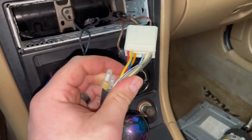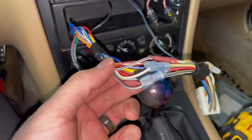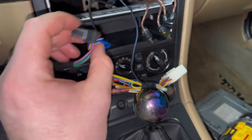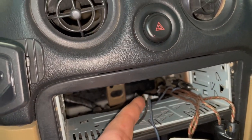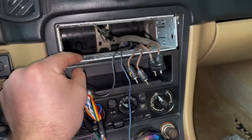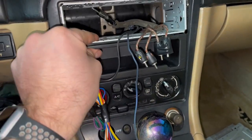Anything that had a color cable coming from the car I connected to the deck harness. This is the harness that goes into the back of the radio and this is the one that goes inside the car. Now that I've got everything connected, I'm going to figure out how to get the rest of this little assembly out — I think I just have a pin to push down right here and then this all should come out.